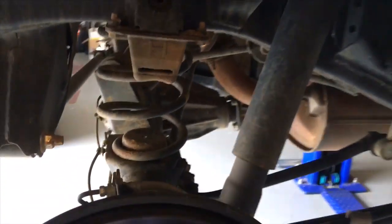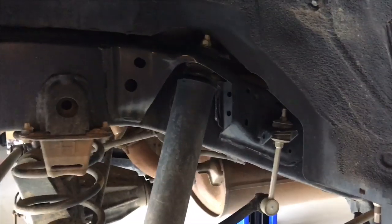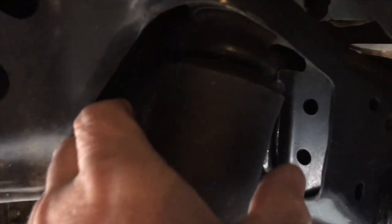So at this stage, we're going to take off those two bolts from the clamps, the ABS and the brake line, and take the rear shockers out. That's a 17 mil at the top here. So you need to hold the shocker here so it doesn't twist, or you can try and get a shifter or something up onto that top part of the rod, or you might be lucky and it doesn't twist. I find it easier to grab it here.